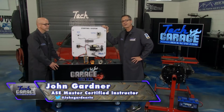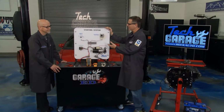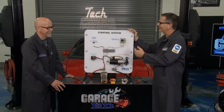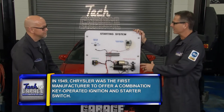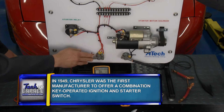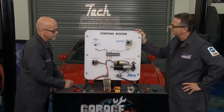Now it's all about the starter diagnostics on Garage Ed today. And what's better than a whole starter board laid out here where we can see everything? Oh, I know what's better. Tom joined us from RockAuto.com. Tom, this is a cool starter system, man. Tell us how it works. Yeah, you've got everything here. You've got the battery, sends power to the relay, that sends power to the solenoid, that then turns over the starter. Give it a spin.